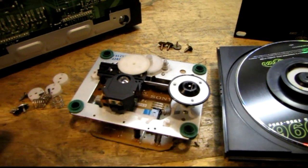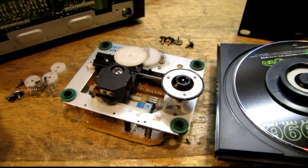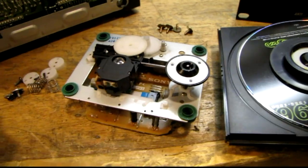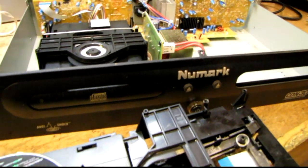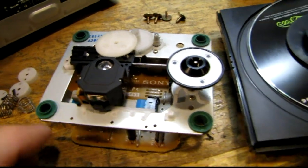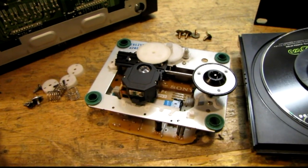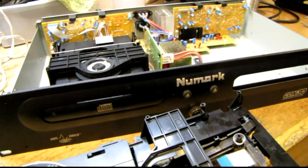It appears I got a defective laser — wasted a lot of time putting it together, taking it apart, putting it back together, figuring out it had a bad connection or something. That new laser just didn't read at all; it did the same thing the old one was doing. I took a laser pickup out of an old CD player that was actually in a bar — a KSS 213C, which like I said I was pretty sure was the same thing but without a dust cover — and put it in, and it worked just fine. So that brand new laser I got is just a dud.